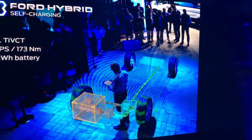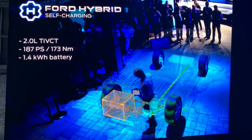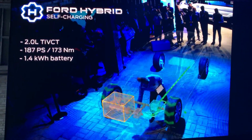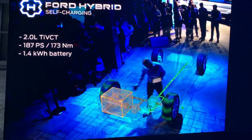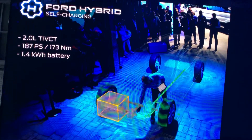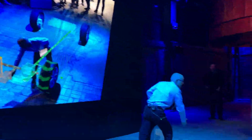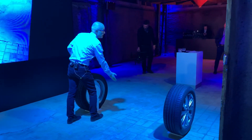You wouldn't notice it. At its heart is the Ford power split transmission — you see the Ford power split transmission here? That is the small box between the engine and the generator. There are actually two electric machines: the first acts mainly as a generator and the second acts mainly as a motor.